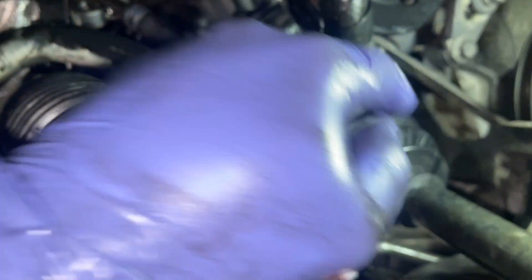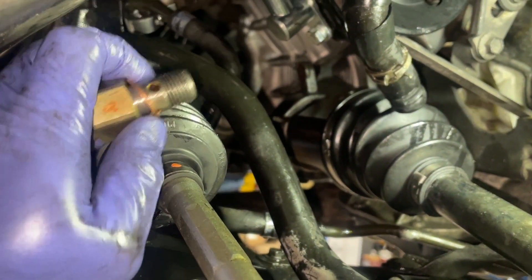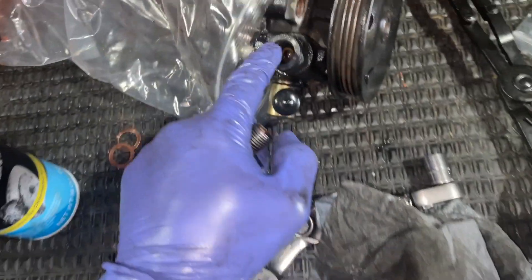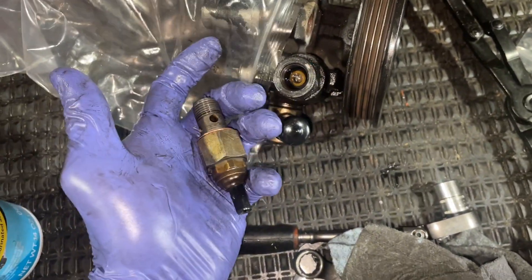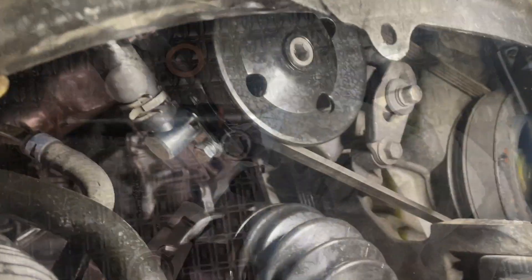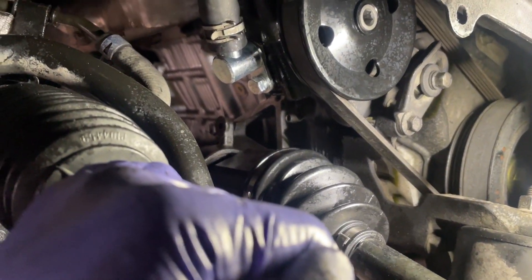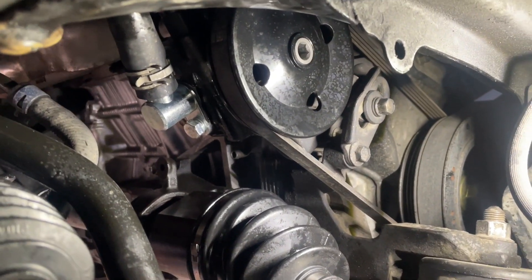Our pump is installed, belt is installed with a little tension. Now go ahead and install the high-pressure hose — the pressure switch sits in there with a new crush washer on this end, and a new crush washer on the power steering pump side. The hose sits like this with the pressure switch on top of the crush washer. This is a 23 millimeter. Once our pump is fully installed, both hoses in place and connectors plugged back in, add Dexron 3 ATF and bleed out the system. Thanks for watching — please like and subscribe for more videos.